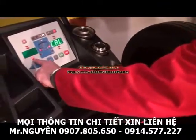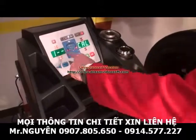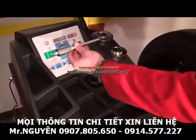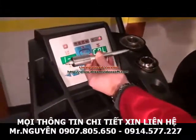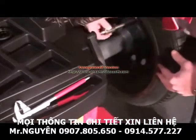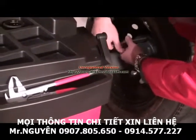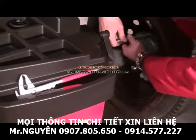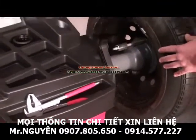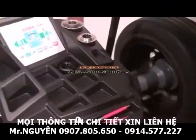Now, we have to bring this to the right position at 12 o'clock. As you can see, you have this sign that basically shows me that the calibration weight goes exactly at 12 o'clock, where the thread is. So, the first step would be to place it right here and perform another spin. This is our second spin.